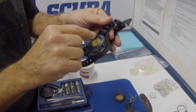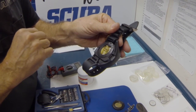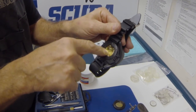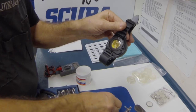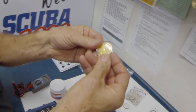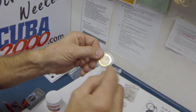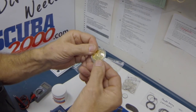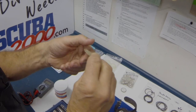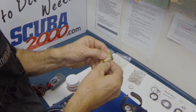Other computers require you to take the wristband off before you can get the back door off. Then there's a special tool to take the back door off, and that pops out. Underneath, here's what the door looks like when it comes off — there's a rather interesting-looking cover underneath. This is actually the buzzer. If you have an audible alarm on your computer, this is the thing that goes 'zzzz' when the alarm goes off. It's part of the actual cover, not inexpensive to replace, and it can be scratched very easily with a pick or a screwdriver.